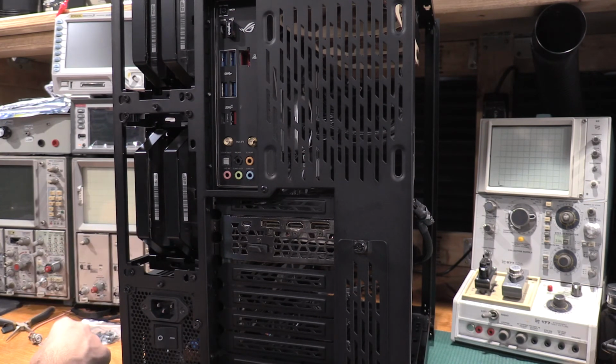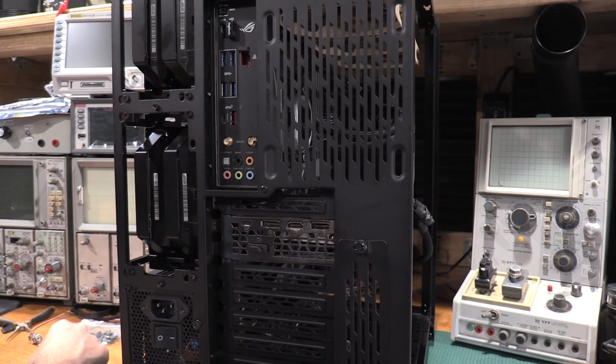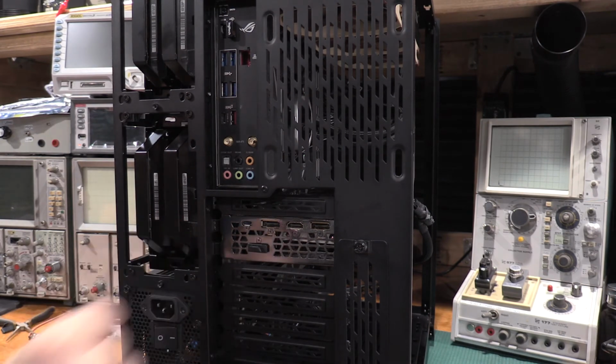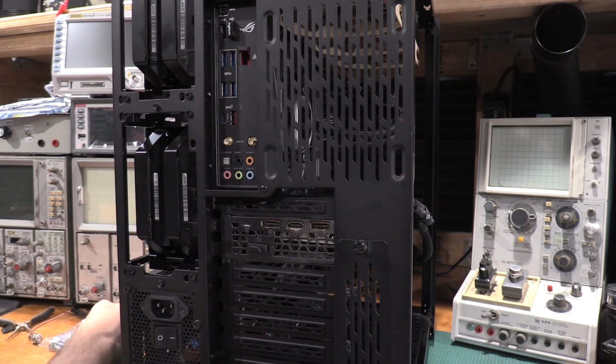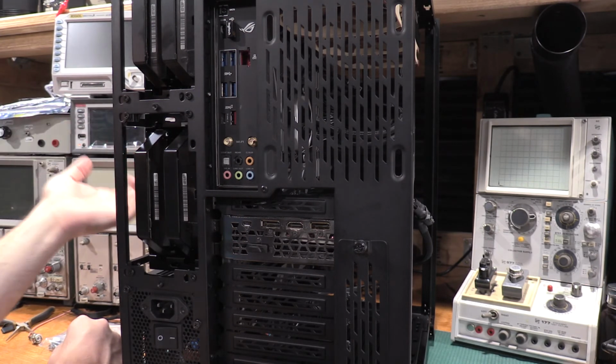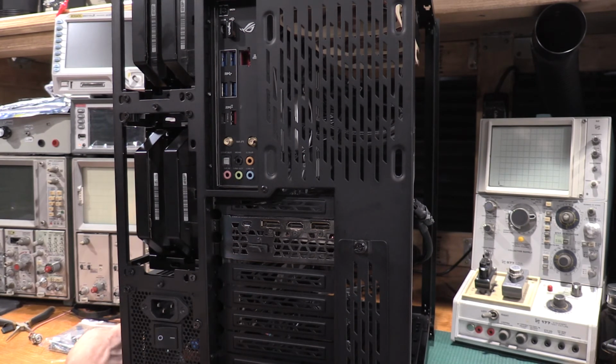This is fine. I also get the Intel Rapid Storage, which allows me to do the RAID. For home use, and I wouldn't use it in the enterprise, the Intel Rapid Storage is actually pretty good. I started using it back when they did the drive caching. They don't do that anymore, but the drive caching sped it up quite a bit. Now that they have support for full RAID, it's not true hardware RAID because it still steals some CPU cycles, but it's not bad for home use, and it does give you some speed increase.